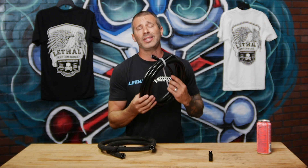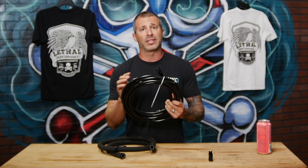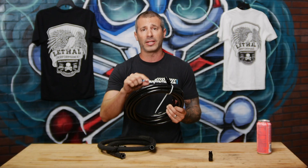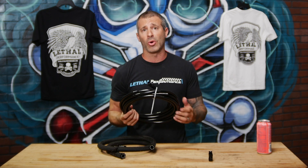The great thing about the PTFE hose is that E85 and other fuels that contain ethanol do not weep or have a fuel smell with this hose. It has a PTFE inner liner on it, it also has a stainless braid on the outside, and then it's covered with a black vinyl coating. The black vinyl coating looks great, and one of its main functions is so that if you install it in your engine bay, the stainless part is not going to be rubbing up against your valve cover, coil covers, or anything that's going to scratch the metal. So it's protective and also looks great.